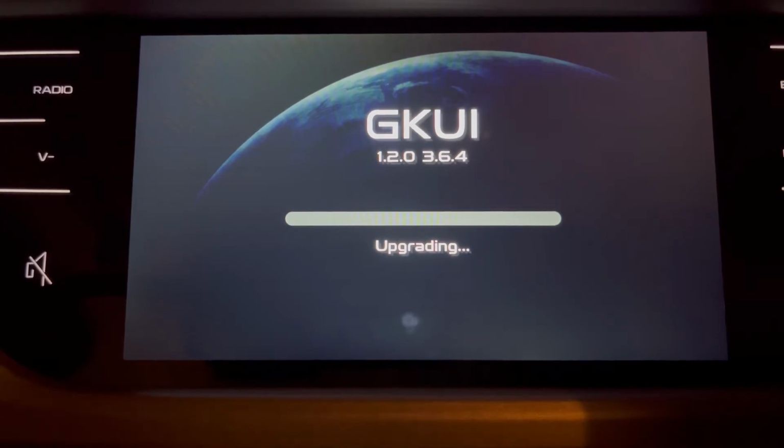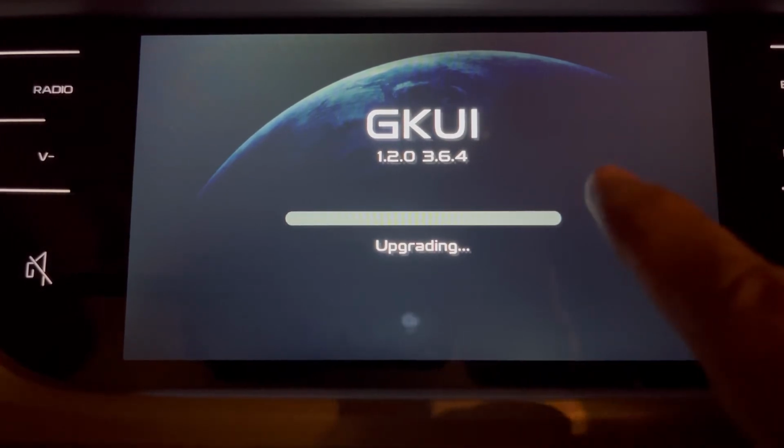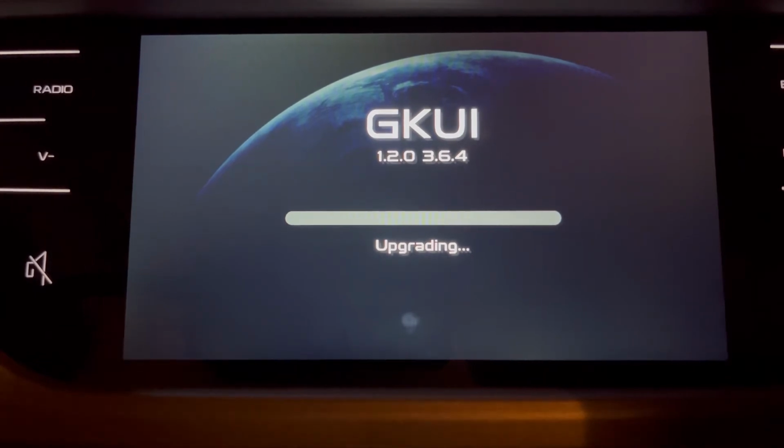By the way, if during this installation or upgrading process you shut down the engine, the whole IHU can be damaged and it cannot be claimed under warranty, and the cost of this repair can be very expensive. So I hope this video helps you avoid those unnecessary headaches or difficulties.